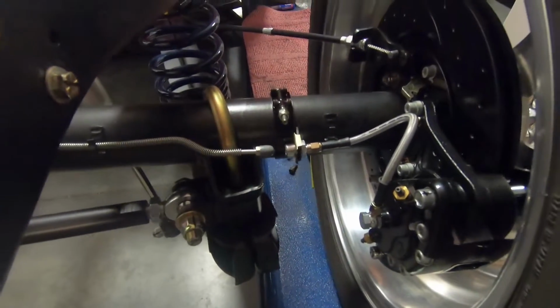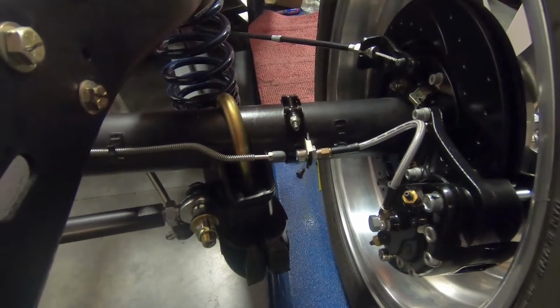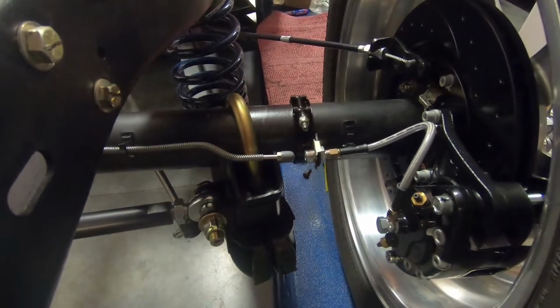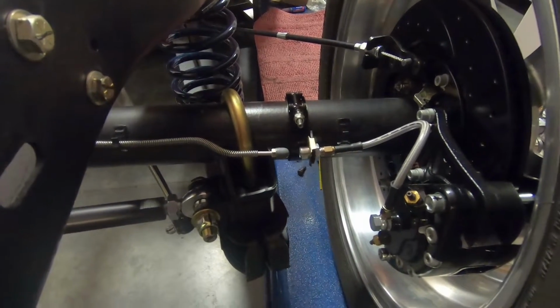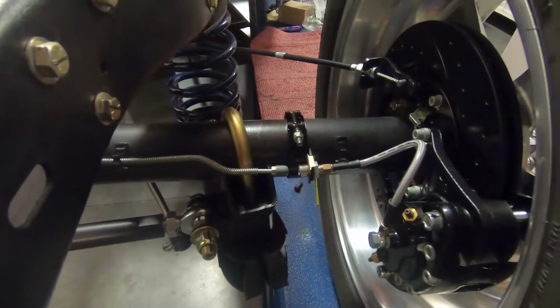All right, so in an unfortunate turn of events, turns out I'm having a problem with this 3/16 stainless tubing. I did it 3 times now, and all 3 times when I do the second step to get the inverted flare, the material tears. It looks like it tears twice. You can feel it when you're flaring. When you first start pulling, it immediately tears, and then it gets tough again.